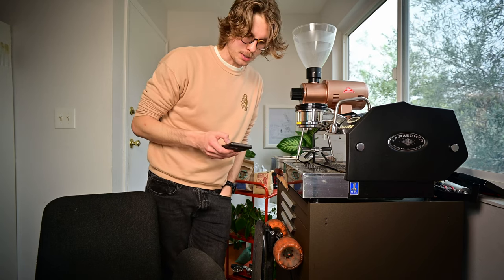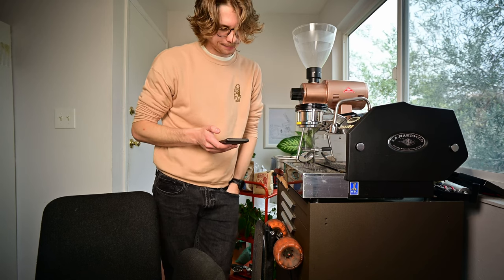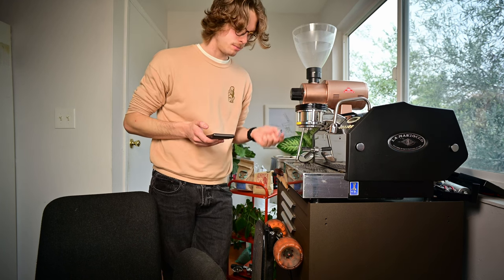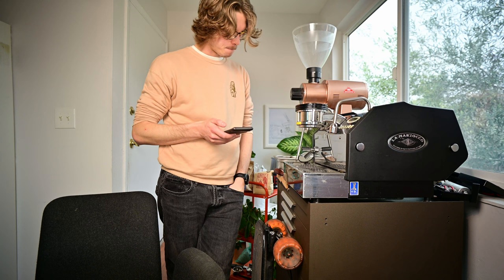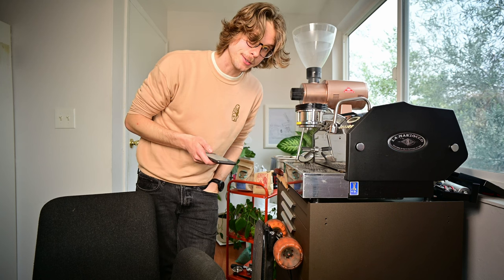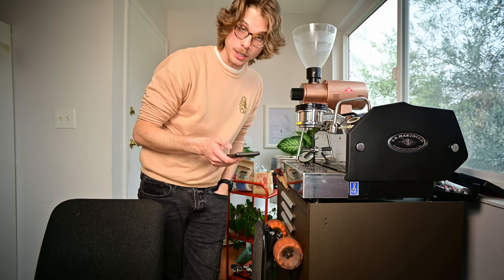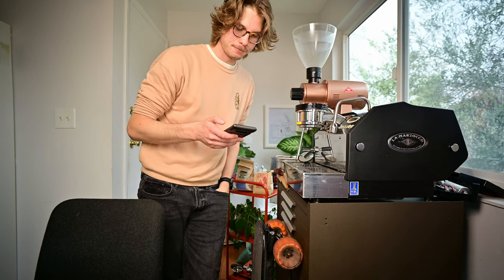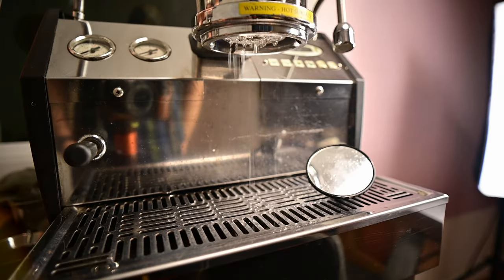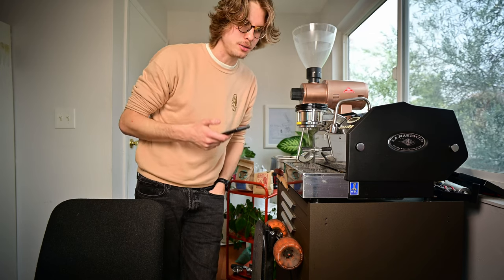Or I can do the opposite, where I turn off the dwell and turn on the bloom. So what's going to happen is it's going to start normally, and the pump turns off but the valve stays open, and I still get some water flowing out. And this is where things get pretty interesting, because we're getting closer to what would be a blooming espresso. Another fun thing we can try is turning off everything except bloom, and then we can actually emulate a bit of line pressure — just opening up the valve and letting a little bit of ambient pressure out, almost like line pressure. This is more close to a traditional pre-infusion.